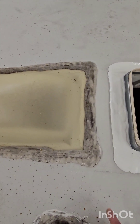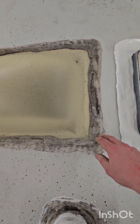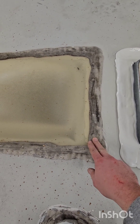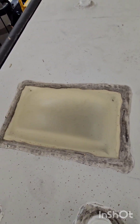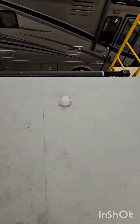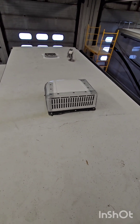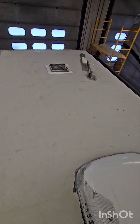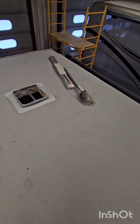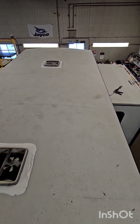When we talk about roof maintenance, this is what we mean — all this cracking could allow water to go inside the lap sealant, get underneath the primary sealant, which could be a butyl or skylight sealant, and then seep into the roof. You can find lap sealant like this anywhere on these campers. So this unit is going to get a rubber roof cleaning, lap sealant applied all around, and then UV treatment to protect the TPO-style roof from the sun. It's also going to get slide out maintenance — cleaning and lubricating the seals and tracks — so everything works flawlessly when camping season arrives.